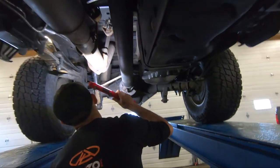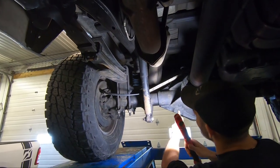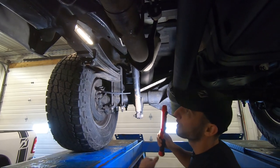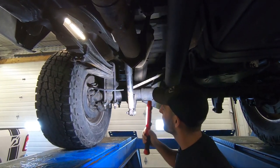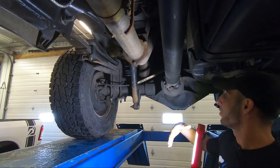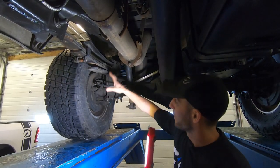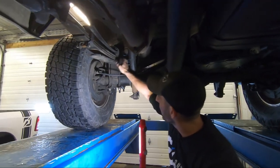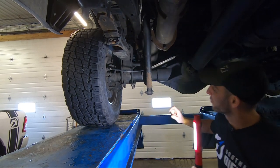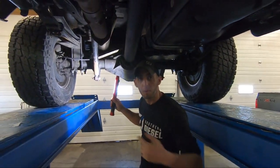Moving to the back — this is totally different from what we're going to cover in an any level setup. This is a factory 350, so it's running a Dana M275 in the back, leaf sprung with two mounting points front and back. There is no four link — it's unneeded with the leaf. Something you do get with leaf spring suspension is axle wrap, so as you accelerate or decelerate, you'll see this pinion angle go up or down. You can correct most of that with a four-link setup, since that also doubles as a traction bar. It's a factory block with U bolts, and shocks are fixed directly to the frame — separate spring, separate shock.